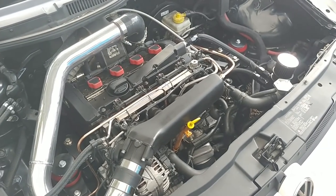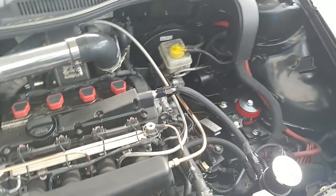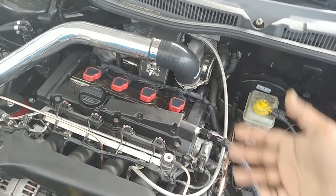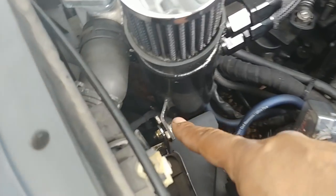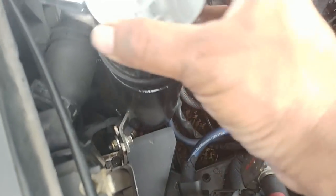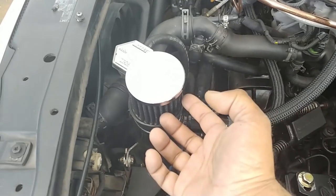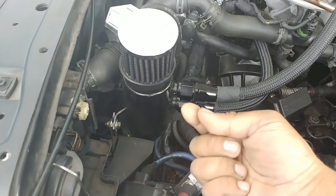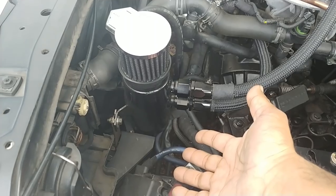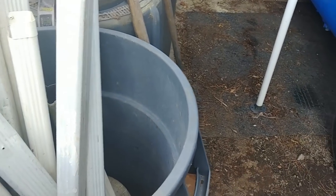What a lot of people do is get a catch can, which is the right thing to do. Instead of dumping it back into your system, you're dumping it into an actual can. I made a little metal bracket, bolted it in - sits really nice and firm and out of the way. All the fumes come in from the crank and the head, go into the can, and accumulate. There's a little petcock on the bottom - you turn that and it drains your junk out.